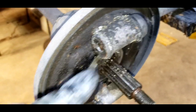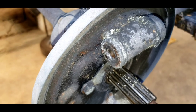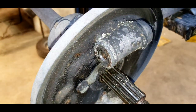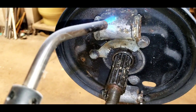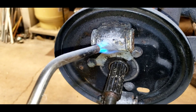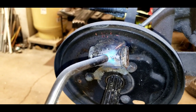So we've got to move on to phase two — we're gonna have to heat this up a little bit. The piston is steel and the wheel cylinder is aluminum; we've got two dissimilar metals that have bonded together. We're gonna get a little map gas torch and see if we can just warm this up — we don't want to melt it or warp it in any way. We got rid of the dust seals, but there are rubber seals in there that we're gonna replace. We've got to get this wheel cylinder warmed up to expand it and loosen up those stuck pistons.